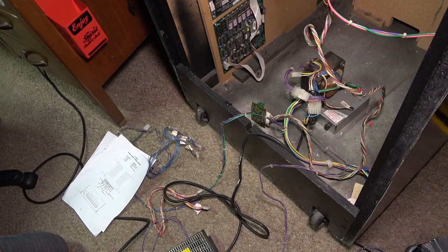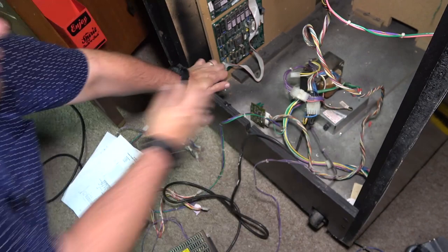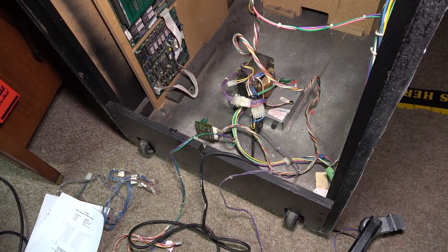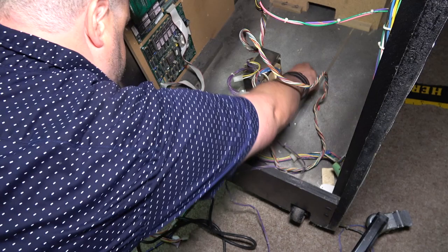And I don't seem to have that wire. I think we should make it though, and we can have it go to this right here with these other earth grounds. I don't know if you guys can see that, but right over there, we can have it run to that. But I'll have to get a wire and crimp that little round connector on, and then we'll loosen this and then tighten it on down there. I think we should do that.